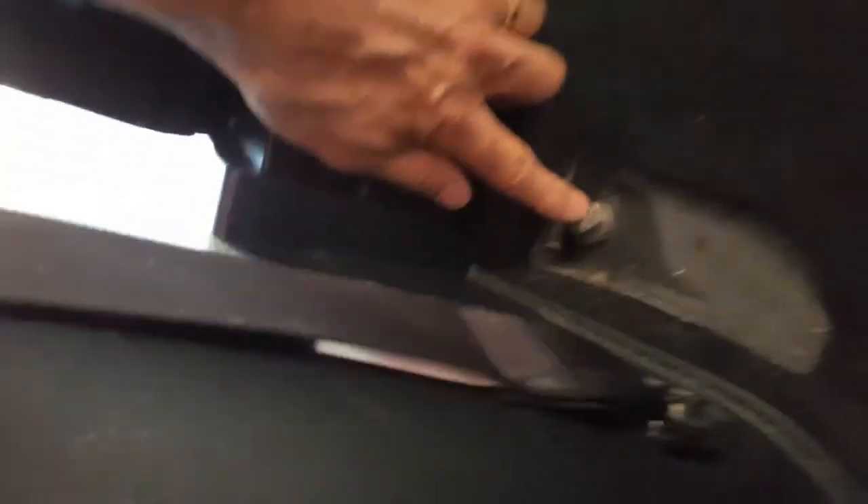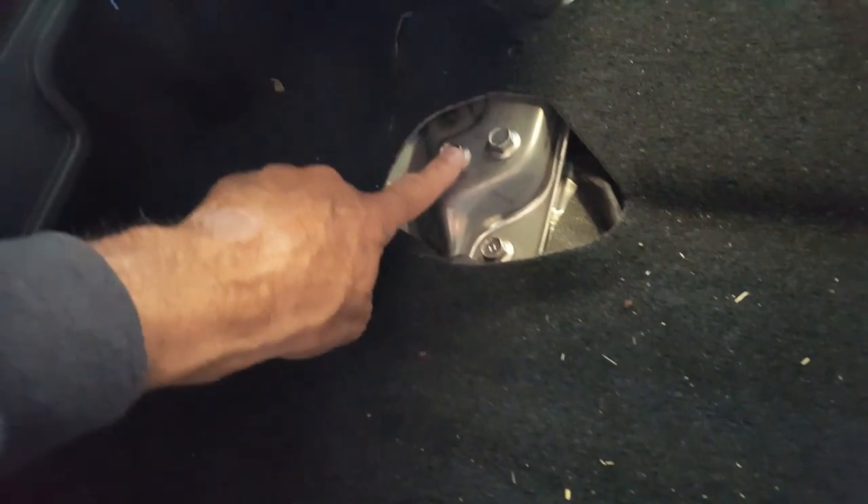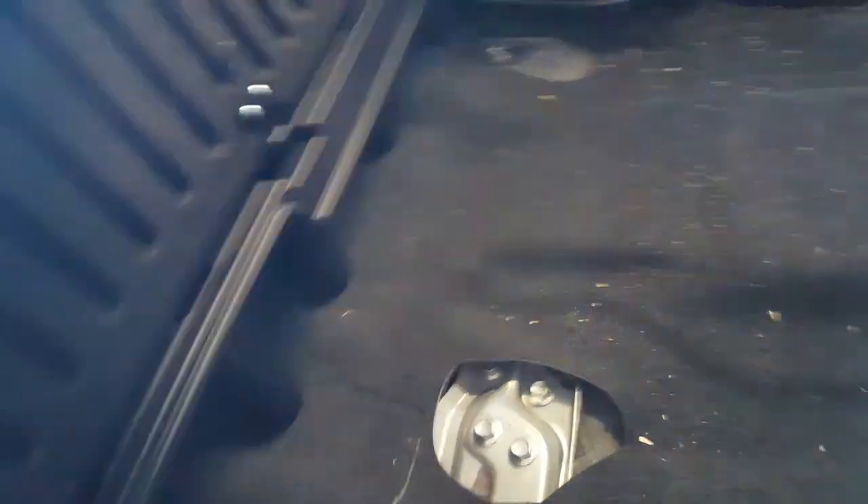As you can see, I've pulled out the back seats. The back seats are fairly easy to remove. There's a screw here, a screw here, just one and another one there, so there are four in the front. There is one here, two in the middle here, two in the middle here, and one on the other side right there. These all use a 14-millimeter or a 9/16 socket, and it takes maybe 15 minutes to get the back seats out of the car.